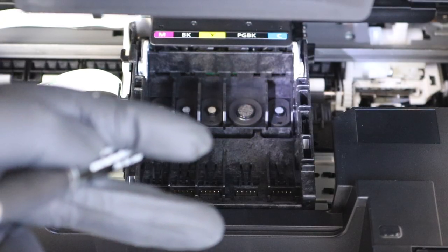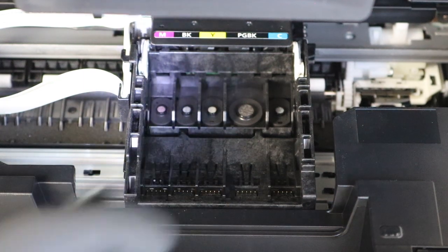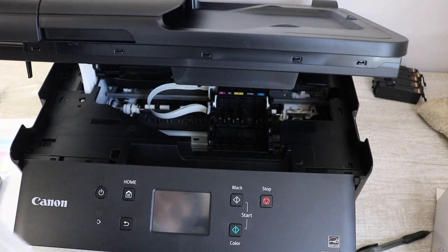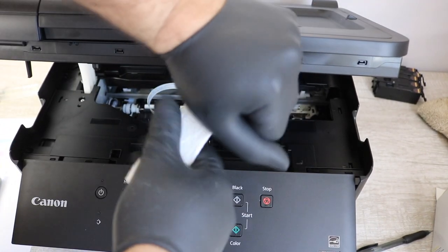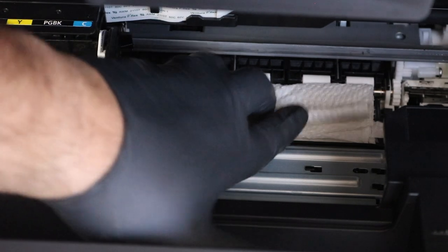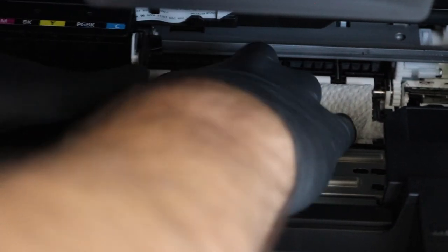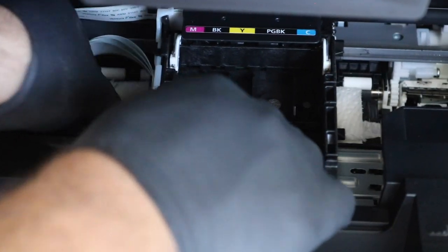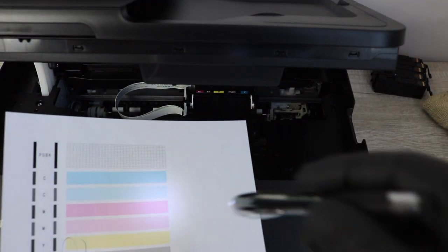What I suggest is starting out with a fresh set of ink cartridges. I'm going to leave a link in the description below for some remanufactured versions of this ink — it's going to be cheaper for you. That is your print head there; take a look at all the colors. Then you're going to be putting a paper towel right under that print head. You're going to have to fold it up quite a few times. Move your print head to the side, place the paper towel right under there — your goal is to get the print head right in the middle of the paper towel. The paper towel is going to collect all of the ink and cleaning solution that's going to be pushed through the print head.